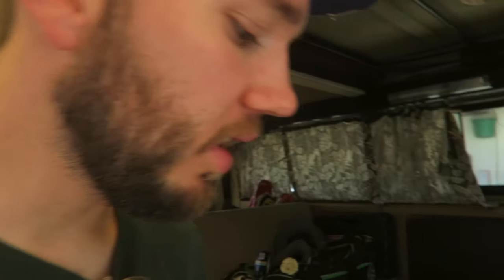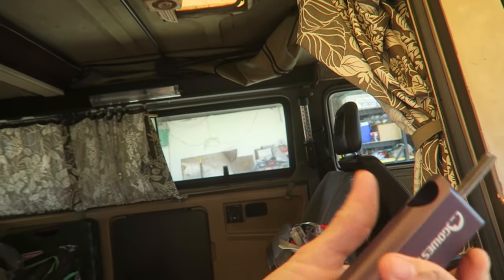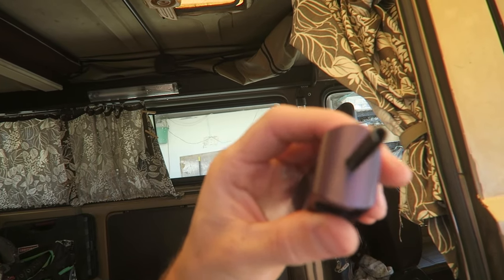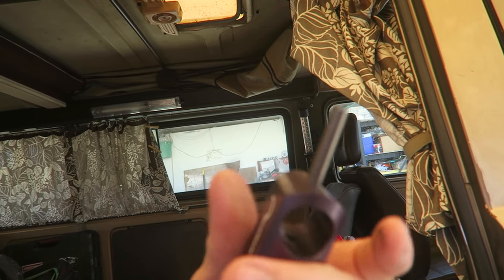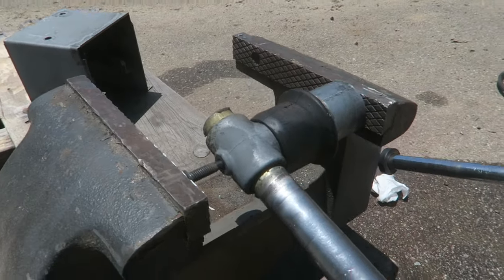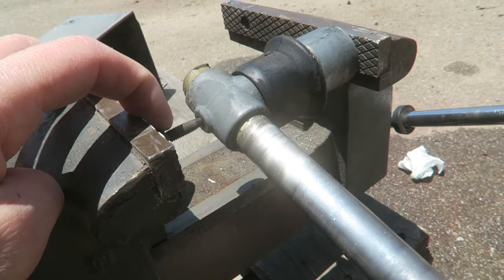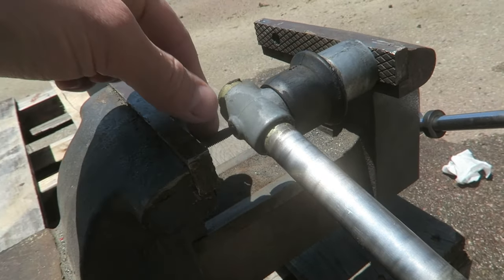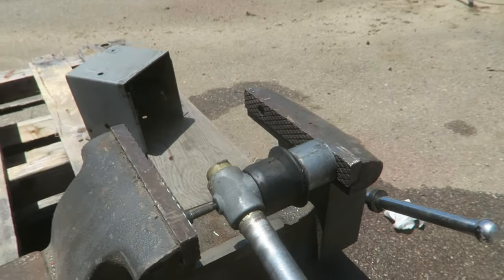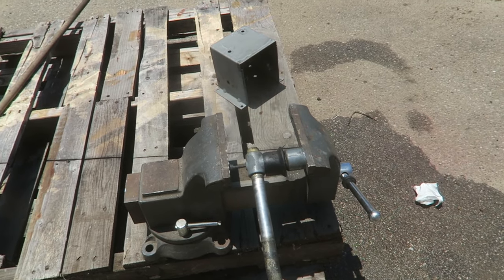All the parts are drying — pressure washed everything. So this is the shifter selector right here. This one's a billet one made by GoWesty, as I showed you in the beginning of the video. There's this roll pin right there, and these things are a pain in the butt to get in and out. But I came up with a pretty good idea. I got a random bolt that's like the same size as that roll pin, and I put it between my vise and I'm just going to crank the vise and push that roll pin in. I already got it kind of started.